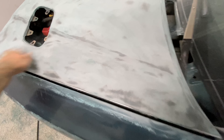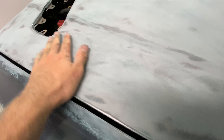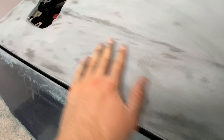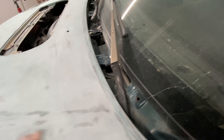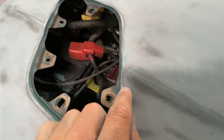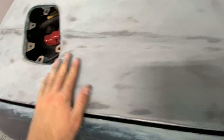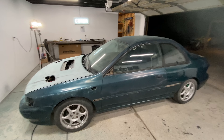This is clearly some green paint left. This is clearly primer. This is clearly metal showing. It's not a bad thing to have metal showing from my understanding. We just want to buzz off the paint so that we can get this thing nice and smooth, but this is just 80 grit so it's real rough right now. I'm just trying to find all these green areas — there's some green right here, there's some green right there. There's majority of it gone. Some of this stuff I don't know how close I'm going to get, but now I have a good idea of what's going on and now I'm excited.